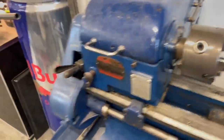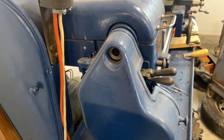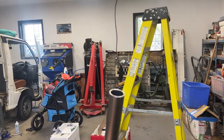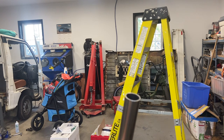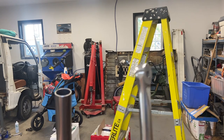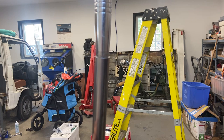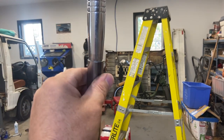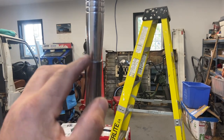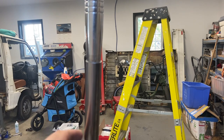I just found out this won't work in my lathe — it's pretty sketchy holding something that long hanging out the headstock, and the spindle bore is actually slightly too small. So I'm just going to file them up a bit and then look at tapering them. To swage these ends — or flare them out — I took an old broken breaker bar, cut the end off, and it has a nice taper on it. I put one end of the pipe on a block of wood and just beat it in with a hammer. It slowly flares the end out so that when you push the hose over top and clamp it down, the clamp sits behind this raised ring. It's not as nice as the original, but it works. Make sure you file it really nice after so the edge is rounded over.